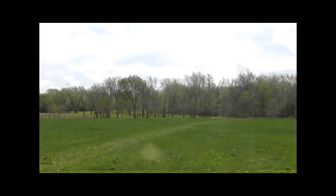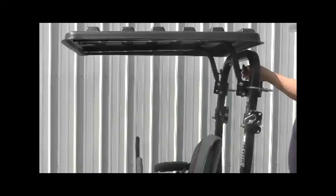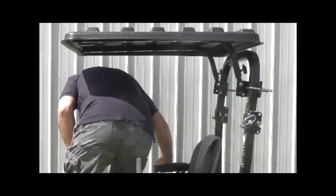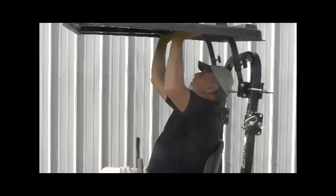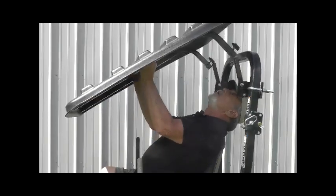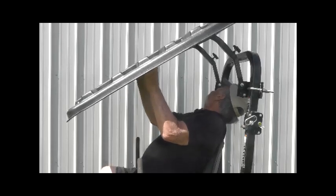It's time to go back and trim around all my trees with my Ferris — this is about the only time I ever take the Rhino Hide canopy off my mower. Let me show you how easy it is with the easy-off struts. First, you loosen the hand knob on each side, then just push straight up using the struts as hand holds. To reinstall, just put the strut ends on the bracket pins, pull and slide down, then retighten the hand knobs.